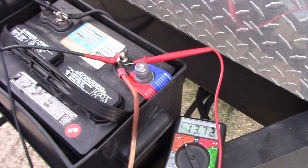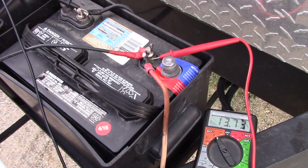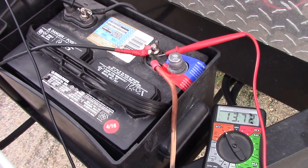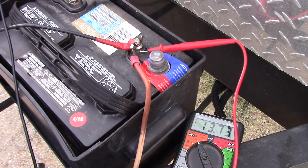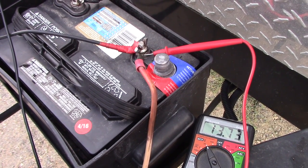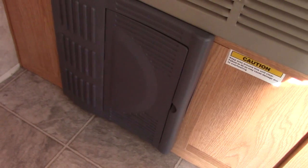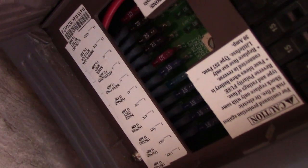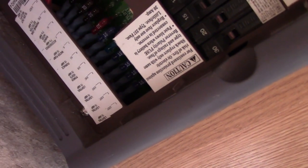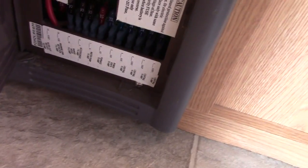So that is how I check to make sure that the charging system on the trailer is charging the batteries. If for some reason this number doesn't change and it stays the same, then you may have a problem with your converter that converts 110 down to 12 volt. Or you may have a bad fuse. So check your fuses first, and then it could be a possible converter problem. This is where you want to locate your fuse box and double check all those fuses. Test them — pull them out one by one, or if you have a detailed list on your fuse box you can eliminate them that way. Better to check every one and make sure nothing is blown.